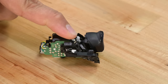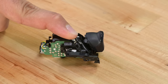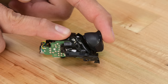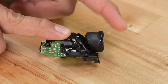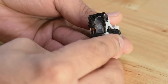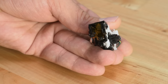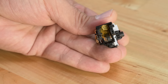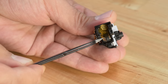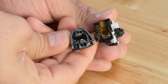That hair trigger mechanism we looked at earlier — this switch is part of that mechanism. Depending on what sensitivity the trigger is set to, one of three circuits will be activated, letting the controller know where the bottom of the trigger is. That does beg the question: how does the trigger fire if it never touches the membrane at the back? At first glance, the Edge appeared to have the same graphite-activated circuit as the regular DualSense, but lifting the membrane away reveals a Hall Effect sensor for the L2 and R2 triggers. Sure enough, there's a magnet recessed in the trigger.